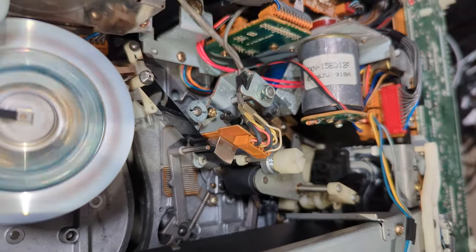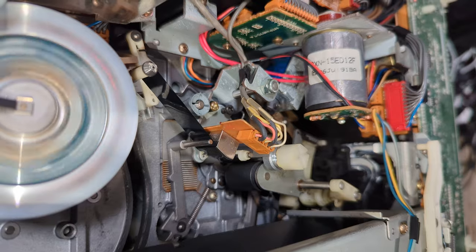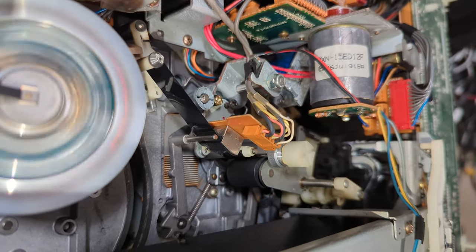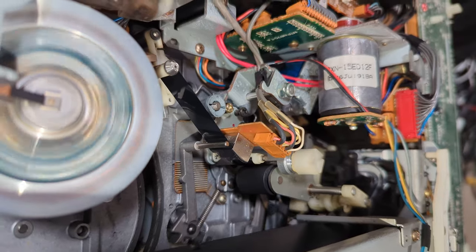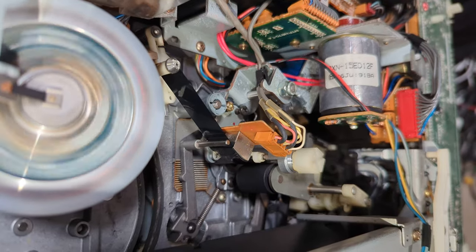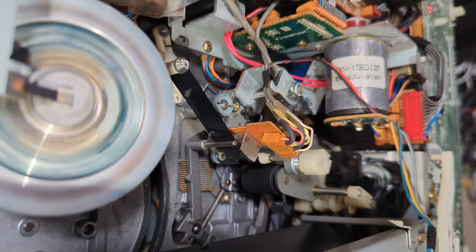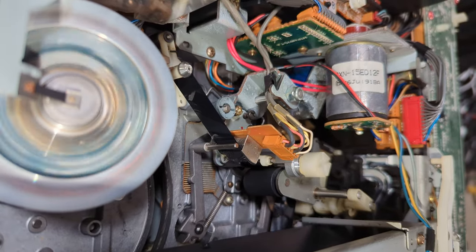Okay, so I'm starting to wonder, you can hear that creaking, whether I actually have a pinch roller problem. Maybe this pinch roller isn't compatible. After all, I mean, obviously the pin is. But you can hear the capstan motor trying to do something. It's in pause at the moment, so I'm just using the jog wheel. The back, forward. You can see some movement. You can see the reflection of the tape moving. So I might have to just investigate that pinch roller, I think.